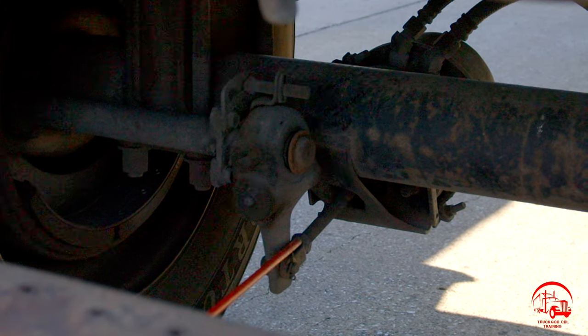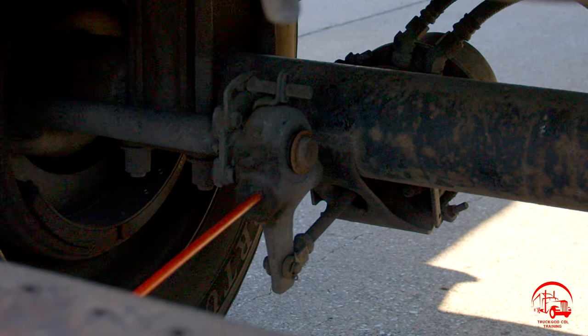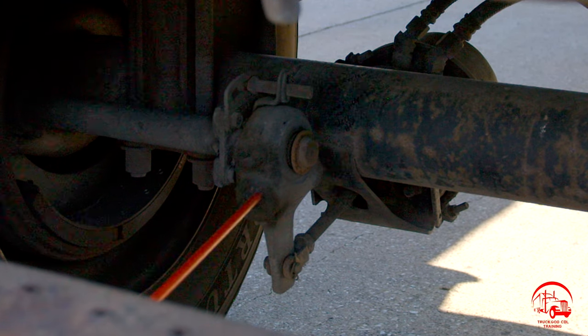There are no illegal welds. Above our push rod, we have our slack adjuster. Slack adjuster is properly mounted and secure, not bent, broken, or cracked. All nuts and bolts are present and tight. It is secure with clevises and cotter pins, and there's no more than 1 inch of play with the brakes